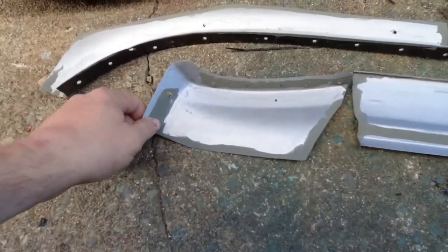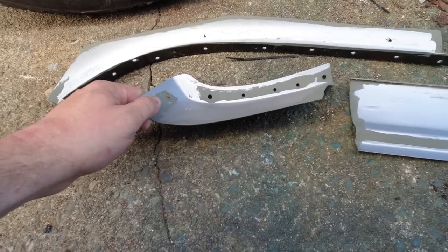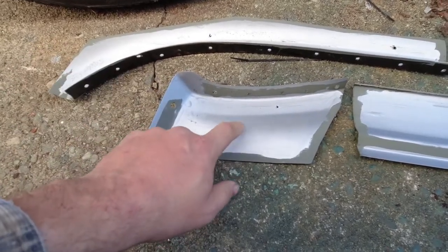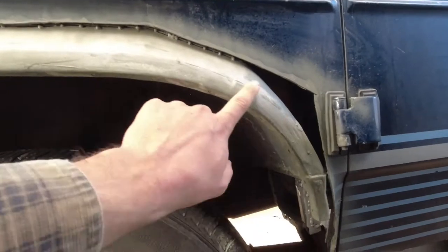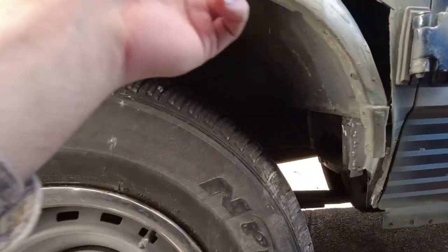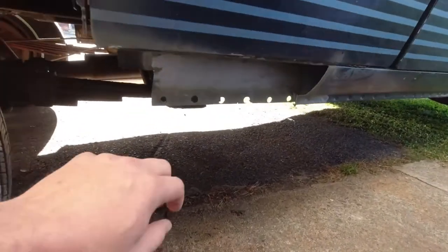The backs of these got the paint ground off where the welds are going to be, and then covered in a coat of zinc-rich primer. And then where I'm not going to be welding, I added a coat of Master Series just as a little extra protection. On the body, I basically did the same thing. Master Series anti-rust paint where I'm not welding, weld through primer where I am welding. I'm not sure I like this weld through primer, but we'll see.